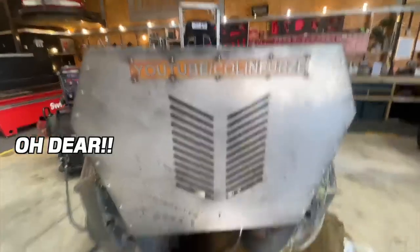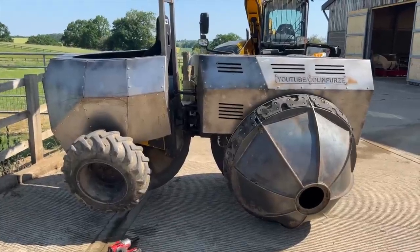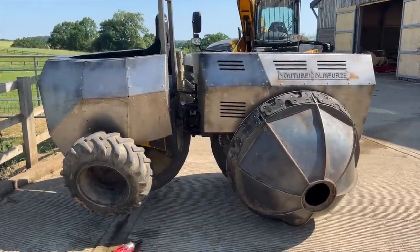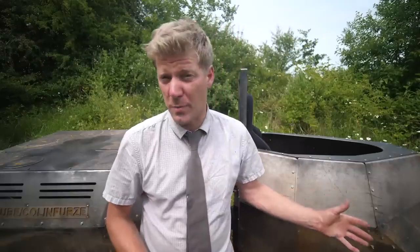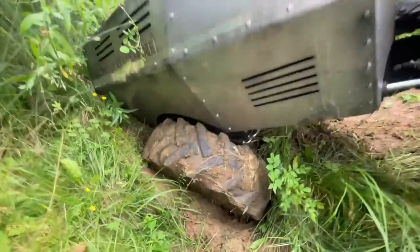I tried a few things — drained the oil, checked it, put new oil in, didn't make a difference. Then I thought, let's put the old wheels back on: if it still doesn't climb banks with the old wheels, I know I've broken something. When you saw the old wheels next to the new big ones, you realise how big these new ones are — that's the main problem. Sure enough with the old wheels it worked just as before. Nothing's broken. I took it for a spin and still got it stuck.